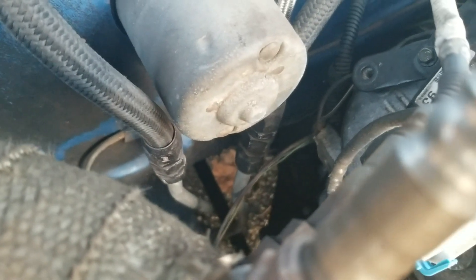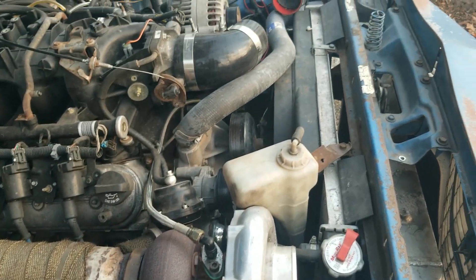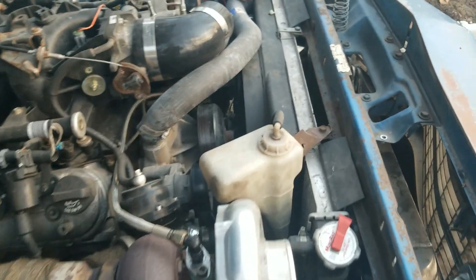There's not a whole lot of room down here for doing a full downpipe to the back of the car because the torsion bars and the trans are pretty tight down there. I'll still try that but we'll see how far that goes. For now the 4-inch fender dumper is a lot of fun — makes a lot of noise and is too loud for daily use, even though I like loud things.